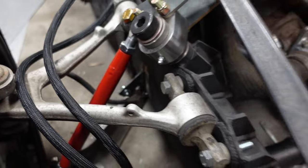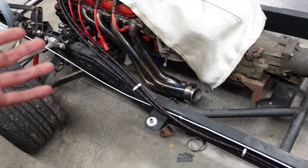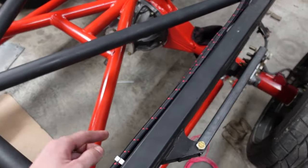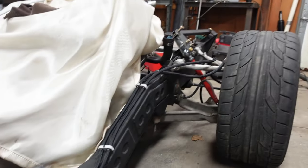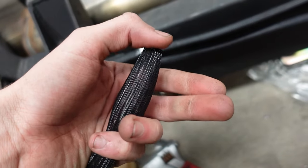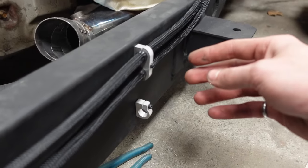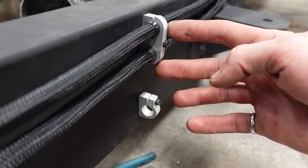There have been a few off-camera late nights where my dad and I finished up the brake lines both in the front and in the rear. The fuel lines have also been mounted. I figured out where I'm gonna put the battery and ran the starter line and the main ground line. Both of the main power lines are two gauge, and I ran wire loom over top for a little extra protection. All of this has been mounted with these custom little clamps that I whipped up — I have a double and a single. I couldn't find anything I liked online at a reasonable price, so I just made my own.